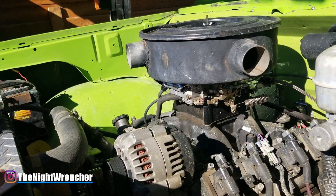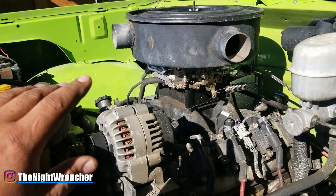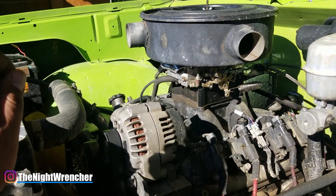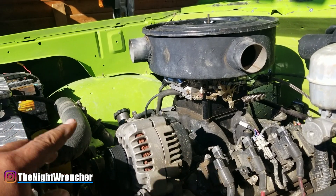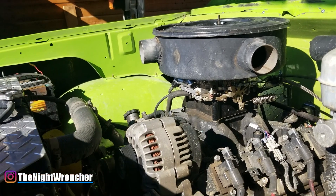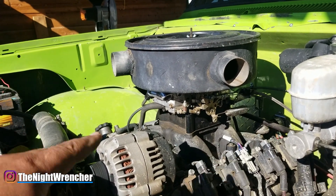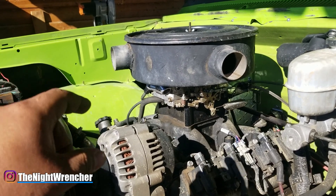The reason I'm installing one of these — a lot of people don't seem to understand why you'd want a 50cc accelerator pump — is because I've leaned out the jets. I'm probably around 14:1 at cruise, and the power valve I've got is a 6.5, but I need to move it up to an 8.5. Any kind of sudden throttle movement pushes it up towards 15–15.5, and if I go too quickly I'll get a little stumble. No amount of jetting or air bleeds will fix that because it's instantaneous. I've already got a 40 nozzle — the nozzle adds more fuel and the pump arm adds more duration — so I need a little more duration. If I'm just driving normally around town I have no issues and get decent fuel mileage, but I do have that hesitation when I stomp on it, like if I want to do a burnout or donuts. As soon as I go into that initial hit, it'll hesitate for a second due to lack of fuel and then quickly pick back up.